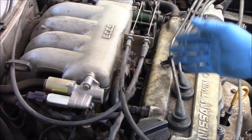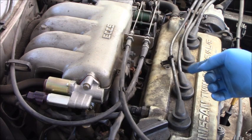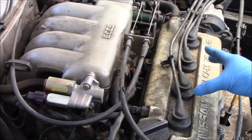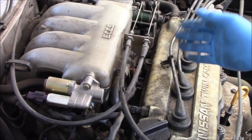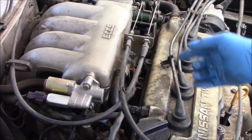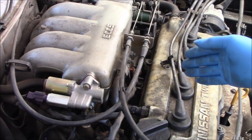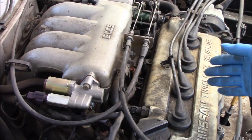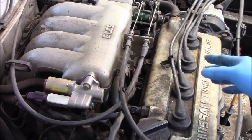You can see the misfire, dead misfire, is caused by one of three reasons: no spark, no fuel, or no compression. And we call that a misfire, all right? I don't want to talk in the video with detail on each reason. I mean, like no fuel: sometimes it's the fuel injector, sometimes it's missing fuel injector control. I don't want to talk about that, it will be long in the video. And now it's time for me to check for the fuel.